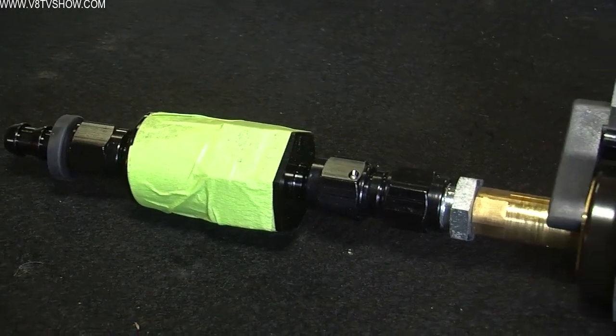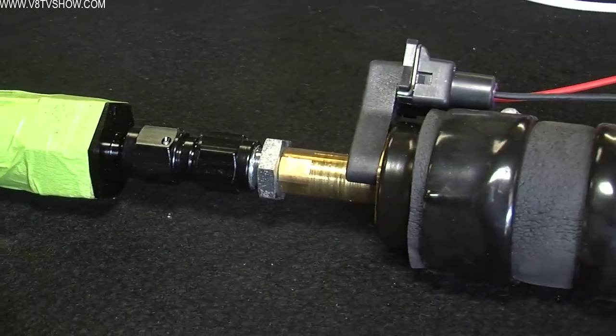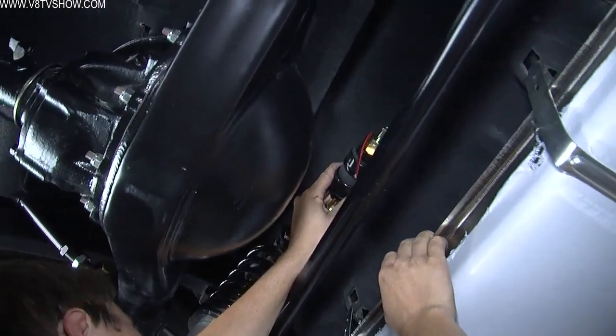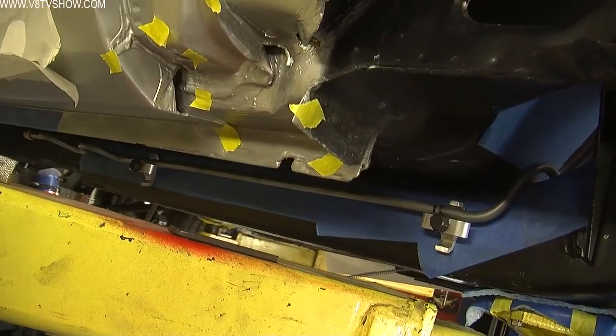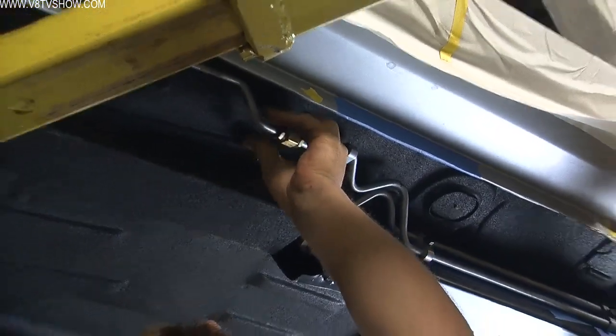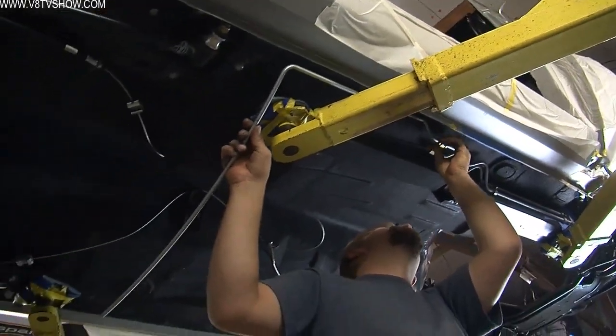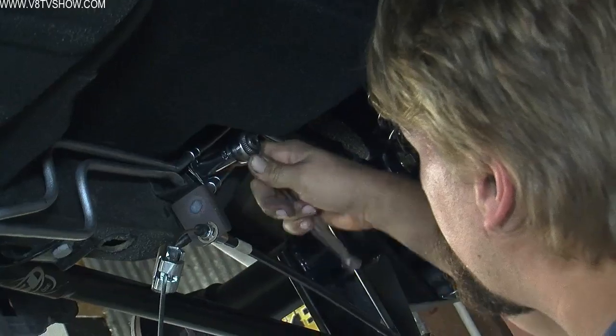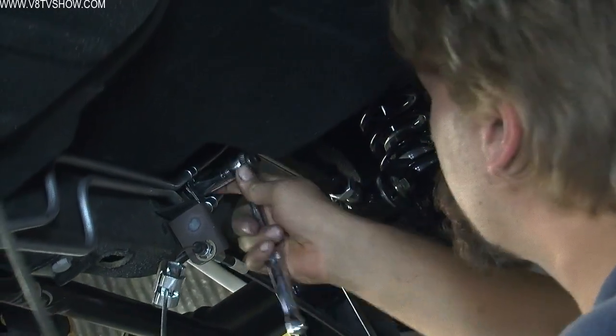Next, Nick took the fuel pump that's supplied in the Fast Easy EFI kit and carefully ground off a place on the rear suspension support box to weld the fuel pump bracket to. After the fuel pump was installed, I was able to start routing the steel fuel lines from the pump to the engine. I like to be very meticulous when I bend steel lines, make sure that all the bends are very precise and crisp, and that everything fits the same or better than the factory would have ever done.